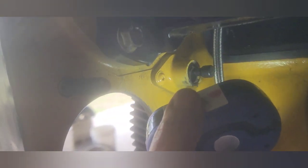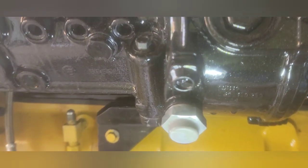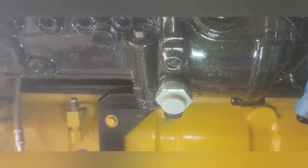If you're familiar with Cummins, you can go get a cup of coffee right now because we're going to look at a couple of things here. Let's turn on the flashlight. Going up underneath — here is the line where the oil connects, and right there is the pin for the cam. You'll notice I've got it in right now. There's a keeper dangling there — I'll fix that in a little bit. And here is the flag for this; it's right here. We've already taken it out and jammed it in there.